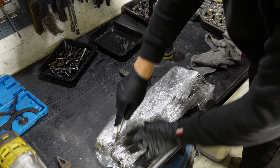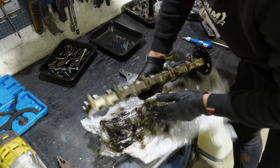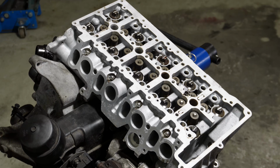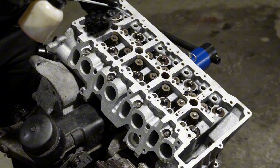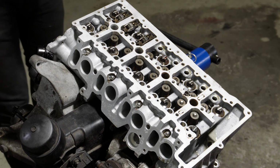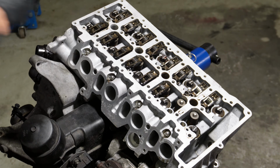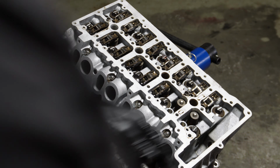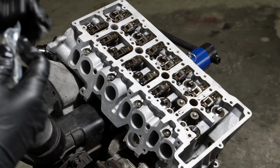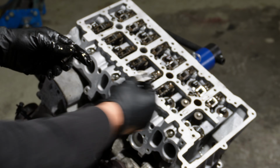Now that's the head sprocket unit. Pretty good design because you don't really need to open up anything. So now I'll put the lifters in. I'm also inspecting them again, just so I'm sure there's no more damage. Like that. And then, as we know, 2 lifters were broken. So here we have new lifters. I know technically you need to replace all of the lifters. Here are the 2 new lifters.